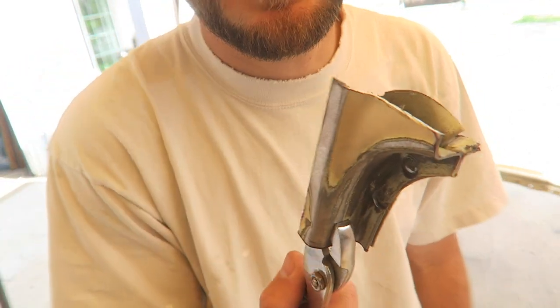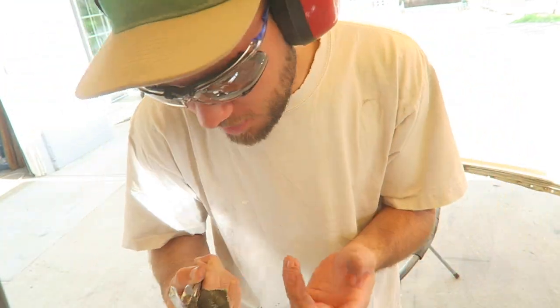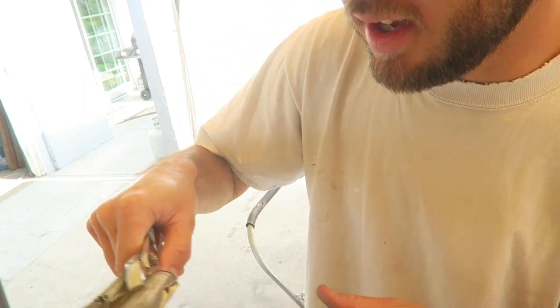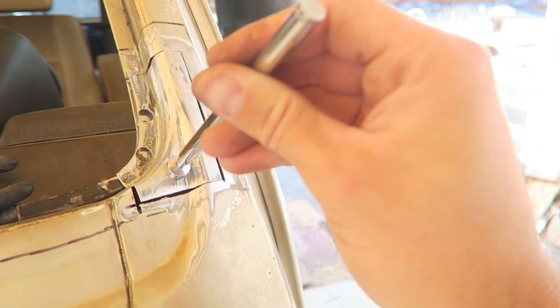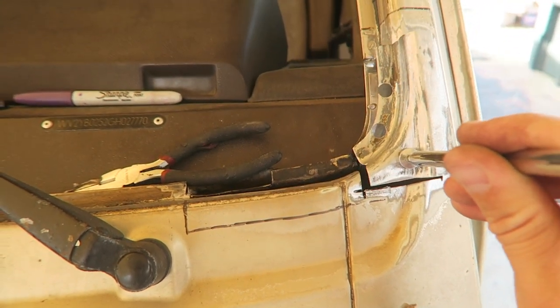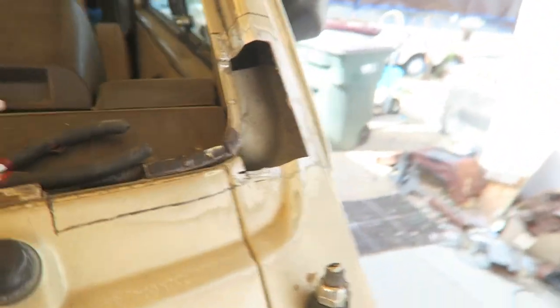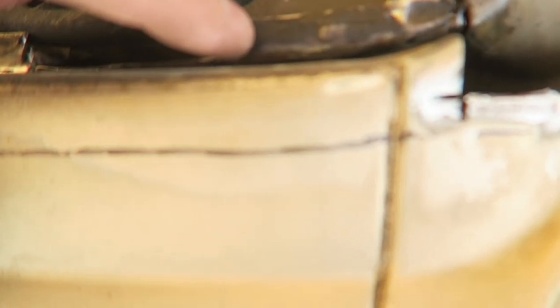Here is the first piece cut out. I've got to grind it down a little more and get it all prepped. There's going to be a ton of trimming involved getting this to fit 100% exactly, because there's a weird body line in that spot. I'm pretty much ready to throw some welds on it. This one piece took quite a long time. The fitment's pretty good though — it fits right in there. I'm going to throw some tacks on it, hit all the corners, make sure everything's flat, then finalize it. Also, that rust neutralizer stuff — I put it on some metal that had light rust on it and it turned it straight-up black. Really interesting.